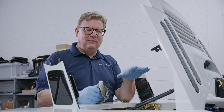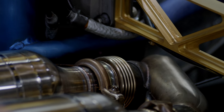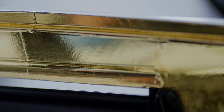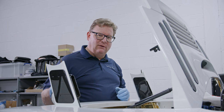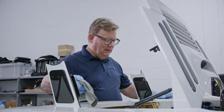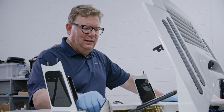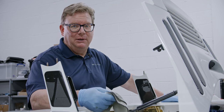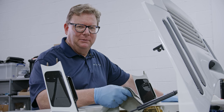We're moving on to the top of the exhaust system — actually the top of the engine compartment, the back section. We've removed the wing, thanks to Kevin. We'll go over the cans nicely, the mufflers through here, across the anodized piece — the bridge here — and then we'll wrap up by taking the water spots off of the gold. This is basically the same metal detailer we used underneath on the heat shield. This stuff works really well because it doesn't leave a residue. I'm always careful — if you put something on these pipes that may stay on there once it goes through a heat cycle, it may be on there permanently. So I use products that come off cleanly.